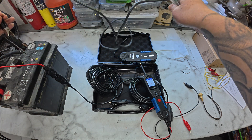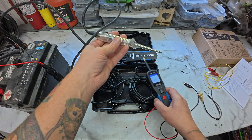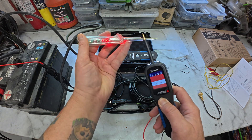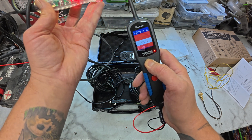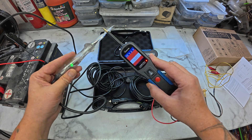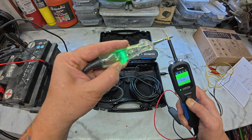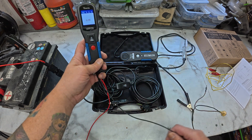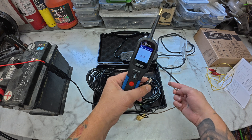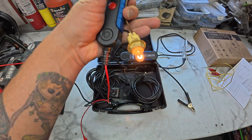Just like the old power probe tools, this V Diag tool will also apply power. I've got my regular test light hooked up on ground. With the tool it shows zero volts, but I can apply voltage to the end of my test light and sure enough it lights up red, showing 12 volts passing through. And the same thing on the opposite end — if we give it ground, the test light lights up a nice green solid ground on the LED. We can also use this black lead as a ground, attach a 194 bulb to the end of it and the other end onto the probe, hit power, and we are getting that bulb to light up.